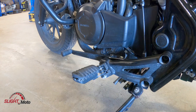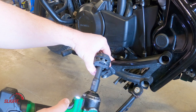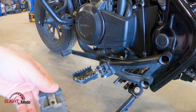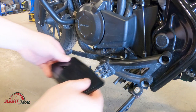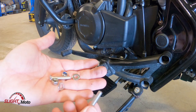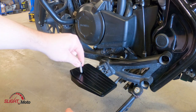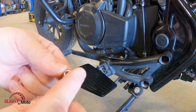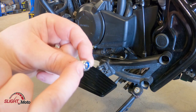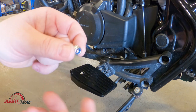It's pretty straightforward. That'll come off, and then that'll just go on like that. It gives you all the hardware you're going to need — your fastener is going to be an allen that slides through. You're not going to need blue loctite because this is actually a lock nut. There's a teflon kind of insert inside, so as it tightens down it actually holds — similar to what loctite would do.